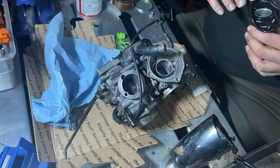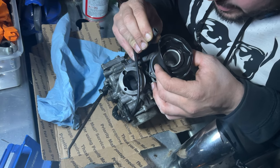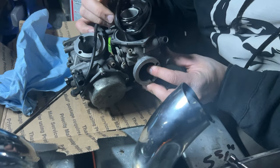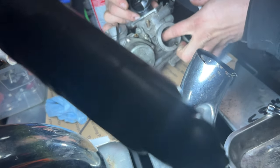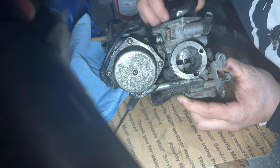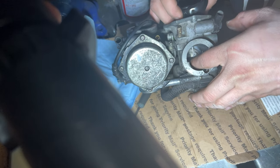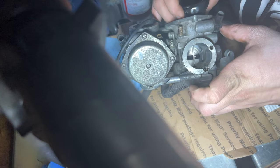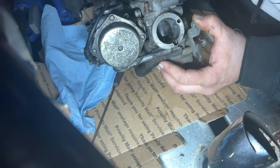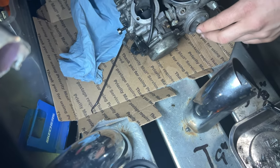This is a lot different design. It allows you to crack the throttle all the way, and then this diaphragm will gradually open up because of the suction. And mine doesn't have that. See, what it does is the diaphragm causes the needle to go up and down. The needle clogs the main jet. Yeah, so when it's all the way in, it's totally clogged. When the diaphragm goes up, it's allowing more gas into the chamber, so you get more, you know, faster.